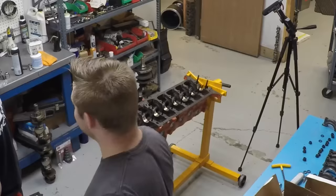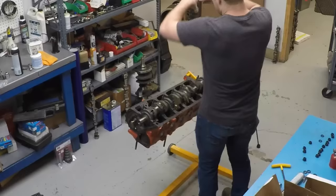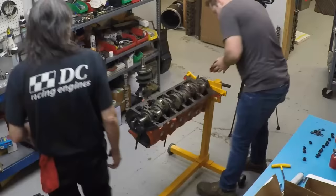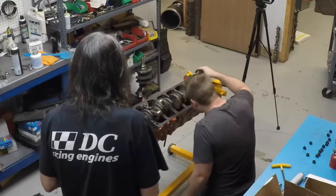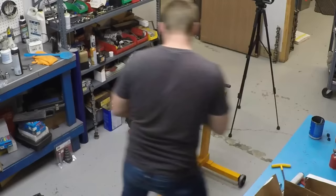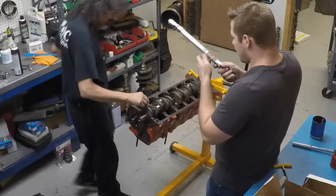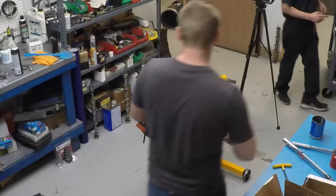Unfortunately, we lost the footage of installing the rear main seal up close before installing the crank. At this point, lower the crank into the block, then place your caps on top of the main journal bearings for the crank, making sure they're adequately lubricated and have the seals installed, and tap them down lightly with a hammer. For the front and rear main seals, repeat the process done on the block: place a bead of engine sealant in the groove, place the cap down, and keep the split in the seal offset from the split in the block where the oil pan attaches. Once all seals and caps are properly seated, torque to final torque using two-thirds, three-quarters, then 100% final torque, in a spiral pattern to ensure even load distribution on the crank journals.